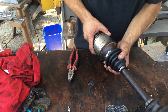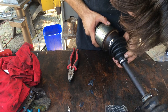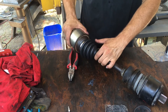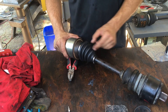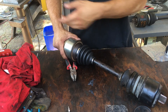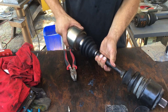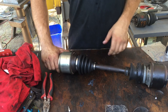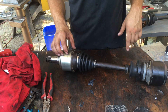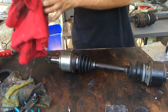I like these boots — I think they're a good product. I think they're better than the original Mercedes boots because they have more bellows. More bellows means less flex per bellow than these originals which only have two; these have four. The rubber is much softer, obviously, because it has to stretch to five times its size to get on here. I think these are going to last a really long time. I hope we've come across a revolutionary product here. The other end is just the same process, so I'm not going to do that on camera. I hope this was informative and educational — that's all, have a good one.